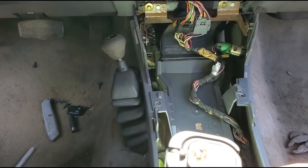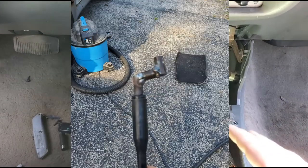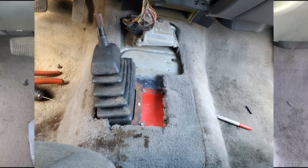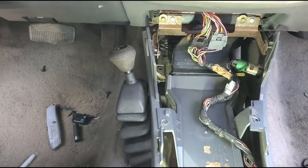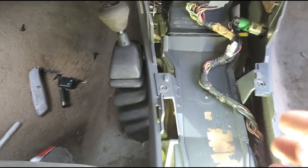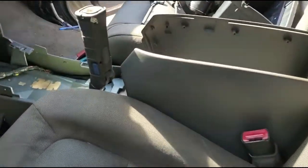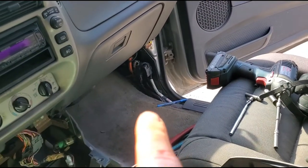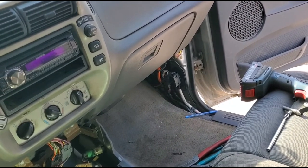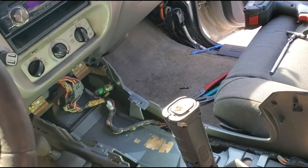I got the center console cut and in where it needs to be — I'm just about done. I took some pictures along the way; I didn't film it because it's just a slow process of going back and forth, measure, cut, measure, cut. Those pictures are scrolling through of what I had to do to the shifter and how much I had to cut out of the console. I still got to trim the carpet a little more, but it's coming together. The factory four-wheel drive computer lives back in the kick panel — I just left it in there, hooked up, didn't touch anything. So that's how you put a manual transfer case in a second-gen Explorer — at least that's how I did it. Thanks for watching. Peace.